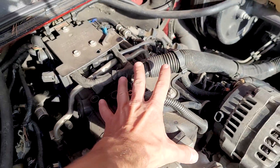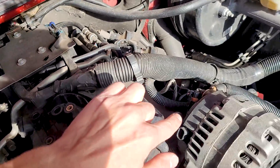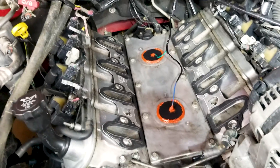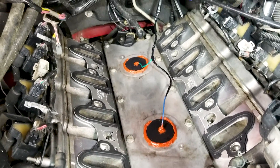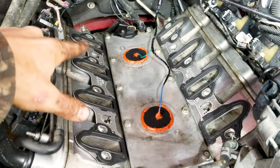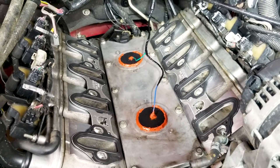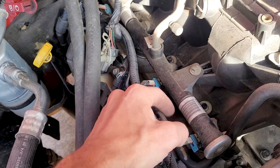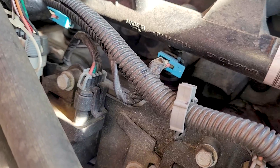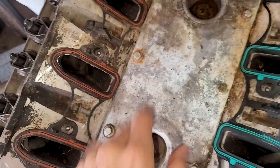The biggest problem with these is the intake manifold gaskets — they're down in here and you can see me replacing them. I use the Felpro ones, the metal ones with the thick rubber. Those seal the best. Getting them installed — when I was doing this knock sensor job — they go right down in there, sealing up great. If you've got the intake off replacing the intake manifold gaskets, swap those knock sensors out and the harness while you're in there, please.